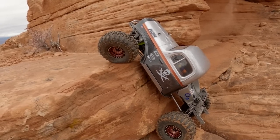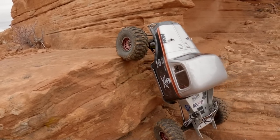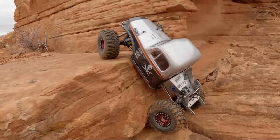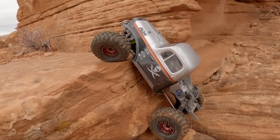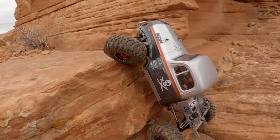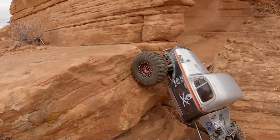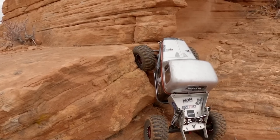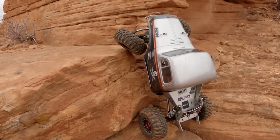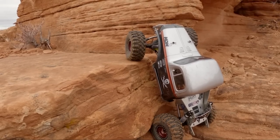This is something that high amounts of overdrive can make kind of funky — if you're backing up, your front tires will outrun your rear tires. And so when you're on a steep ledge and you want to keep your fronts planted up there, they will push off faster than the rears will back up. If you get it real steep, it will just flip your truck over. So you don't want insane amounts of overdrive if you're ever planning on backing up.